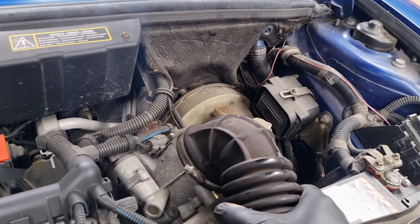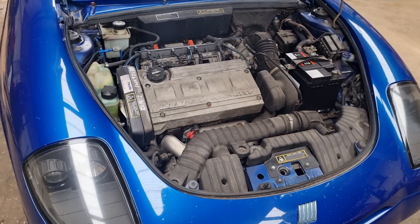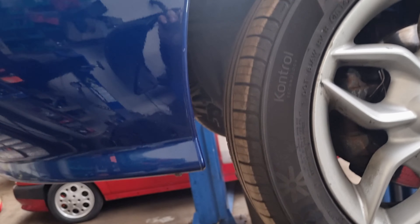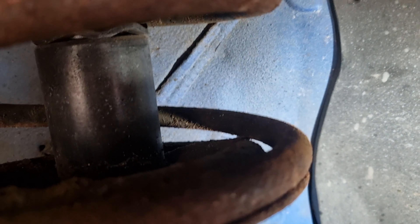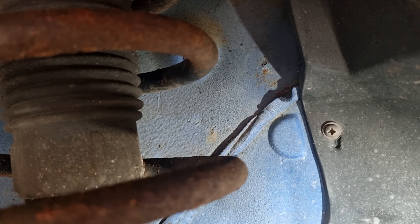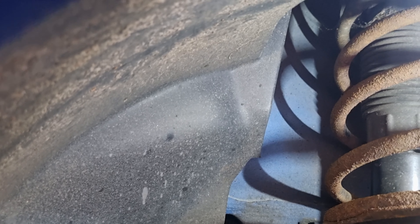The pipe isn't holed or anything like that — it looks good. Let's get it on the ramp and check the underneath and the suspension. Let's take a look under this front corner. We are relatively rust free under there. The front shocker is a little bit corroded in the spring too, but there's no signs of it leaking.